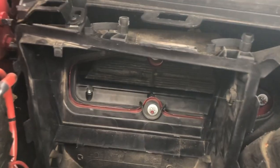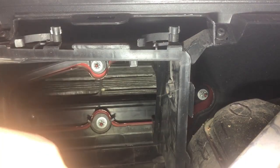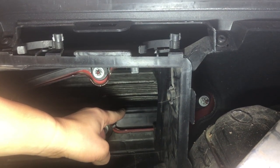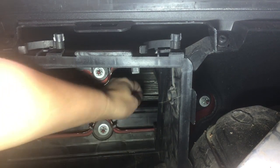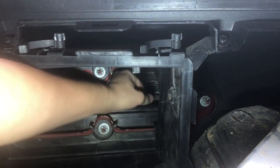Now the next two filters are located under the windshield, right there. The first filter you're going to want to take out is this one — be really careful because this little piece of metal is sharp and this plastic is sharp, so you'll just want to grab the pleats in the front and try to shimmy it on out.